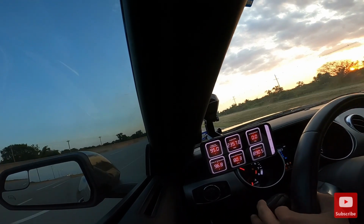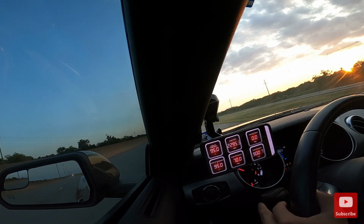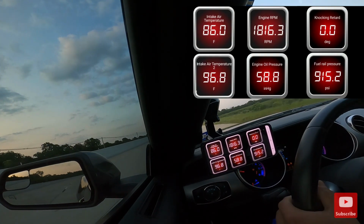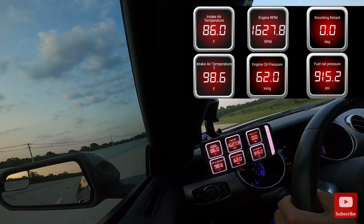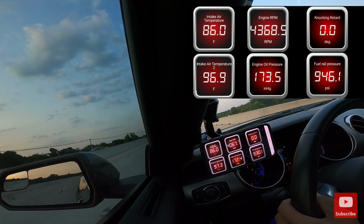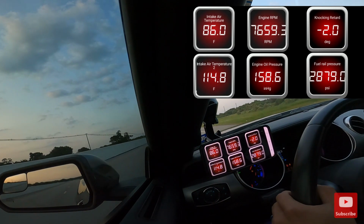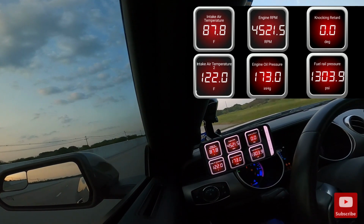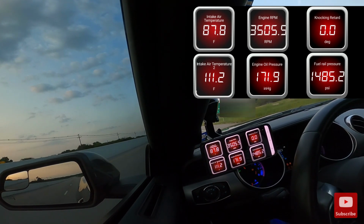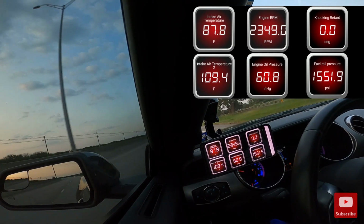But we want to see what it is right before a pull, during the pull, and then after the pull. So that's what I'm gonna get y'all. So let's go ahead and fast forward this to the point where we start doing the pull. Slow it down. It drops 113, 111, and went up to 129, and my timing doesn't start pulling up until 140, says my tuner.